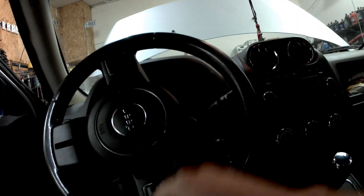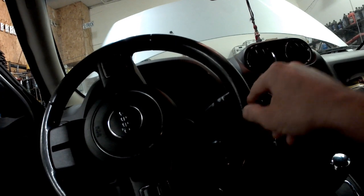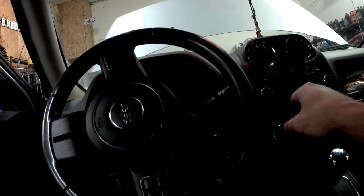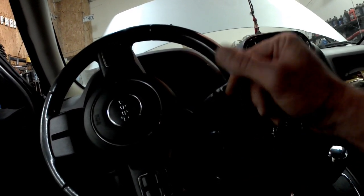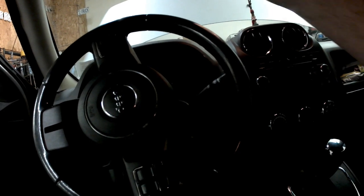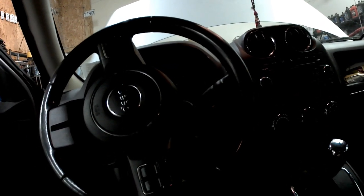If you plug a scan tool in it, you can look at the engine RPM, and it will show you cranking RPM if the crank position sensor is good. Plug in a scan tool to it, it's not showing you any engine RPM. We also did have a code for a crank sensor circuit. I'm going to say the crank sensor is shot again.